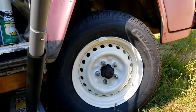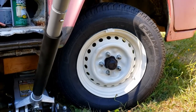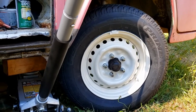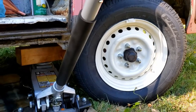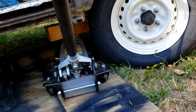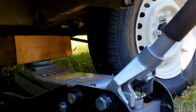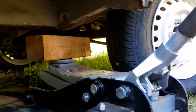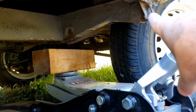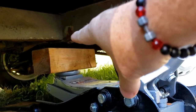Working on our '74 Bay here — front disc brakes on this, we're going to go ahead and swap those out. The old ones I'm sure are toast. Let's get started with jacking this. You can see right behind here is the normal jack position. There's a special set of jacks that come with it, but we're going to use a normal floor jack. We're going to come under here — this is the frame for the jack spot — and come back where it meets the mainframe and lift up right there at the strongest point.